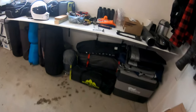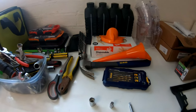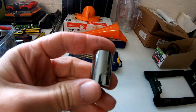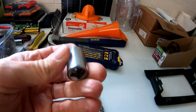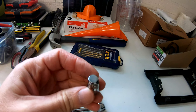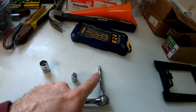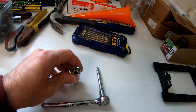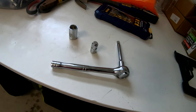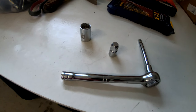The wrench I'm using is a quarter-inch drive. I've got a half-inch socket that's designed for three-eighth-inch drive, so I've got a little adapter — three-eighths of an inch one end, quarter-inch drive the other. That goes onto the wrench, and then onto the adapter. And then we undo the bolts. So what we're going to do now is undo the O2 sensors from the bike, and then start unbolting the pipes from the bike as well.